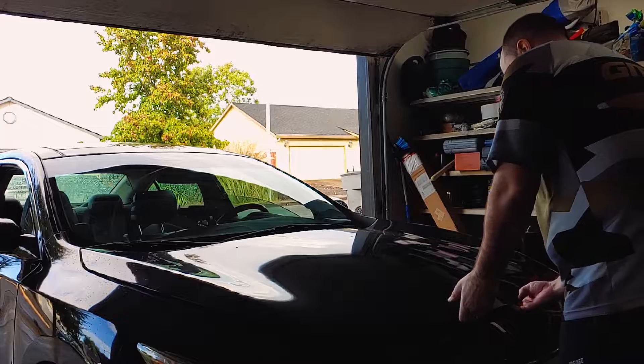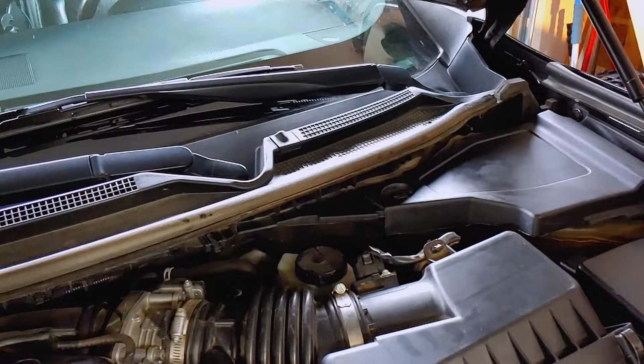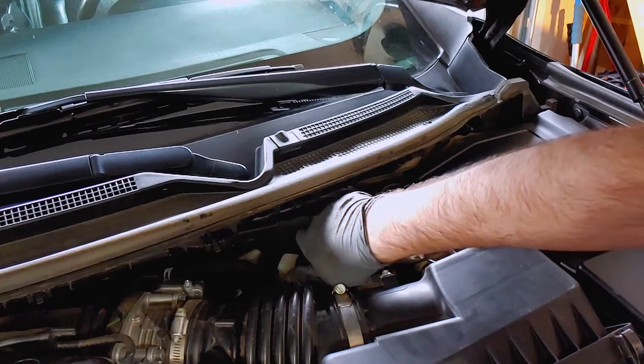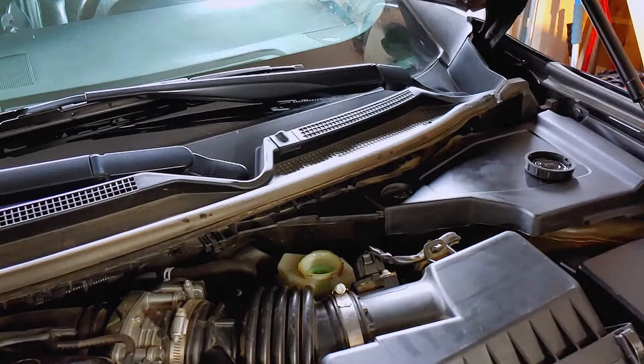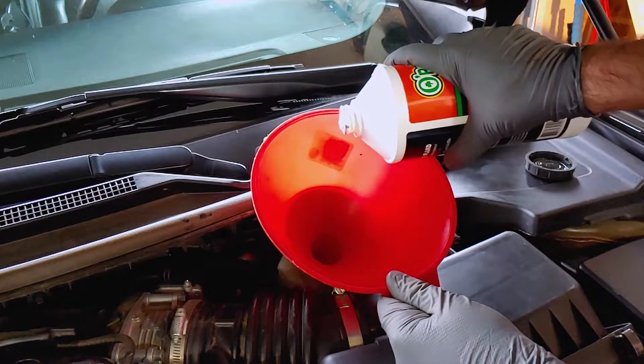It's important to keep the brake fluid reservoir from running dry and sucking air into the lines, so I topped it off every 5 cycles or so. You should continue bleeding the line until you see clean fluid coming out, but sometimes it's hard to tell, so don't be afraid to use up to a quarter of the bottle on each brake line.